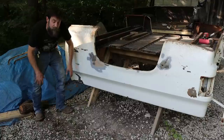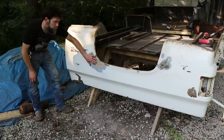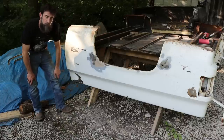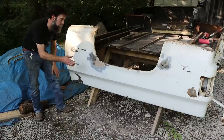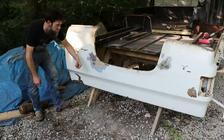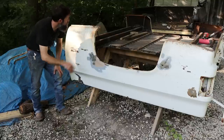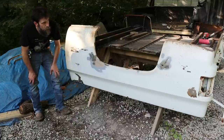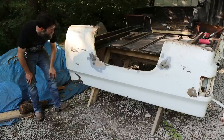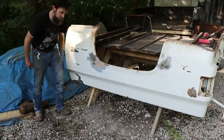In an area like this, if it has to be thick, you know, that's where you would use some fiberglass reinforced body filler, and then you would skim over top of that. You'd sand it low, and then you'd skim over top of that with your standard filler, because it doesn't like to be flexed. Because these beds do, they shake going down the road, and you know, years of that causes filler to break out. So that's the story. It's been hit up here. I can't really see any other major damage on this thing, so I think we're okay. But we'll strip this thing down and get the full story of what's underneath all the paint on this.